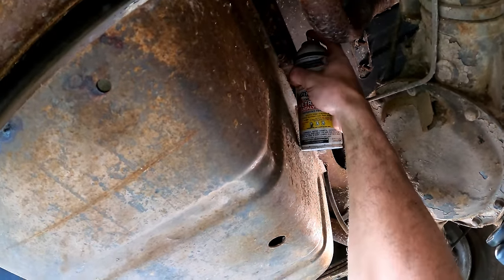Next morning — let's try a cold start at about 50 degrees and try one last thing before we condemn the clutch. I relieved the hydraulic pressure from the line just to make sure it's not a sticking piston in the master cylinder. No good — it just goes right into gear. So the clutch is wiped out on it. If I had a lift here at the house I'd probably drop it because she deserves one. Brake line, a couple other tires, and we'd be ripping around. But it needs a fuel tank, fuel pump, and all that good jazz.